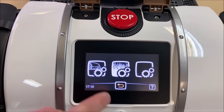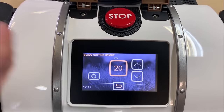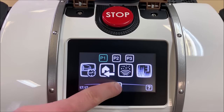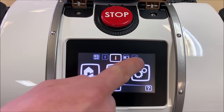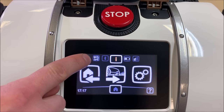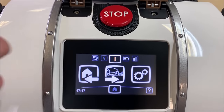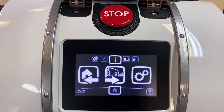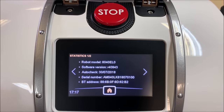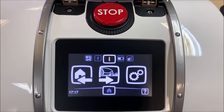From this menu you can adjust things like the height of cut — just go into the height of cut menu, dial in the height you want, and you can hear the motor bringing the blade up or down instantly, which is a really nice feature. Back on the home screen there are various indicators: GPRS or mobile phone signal, GPS satellite connection, a Bluetooth indicator for when the robot is connected to the mobile app for software updates or scheduling, a battery level indicator, and an exclamation mark for information like software version and serial number.